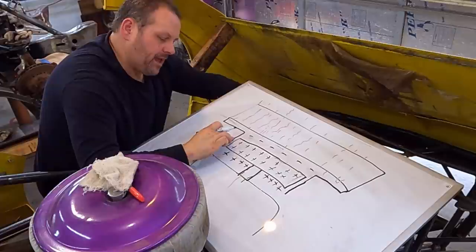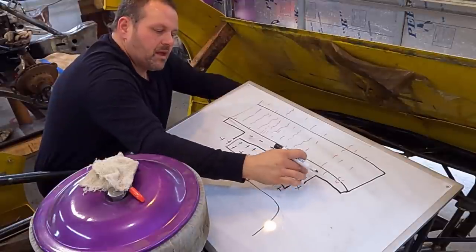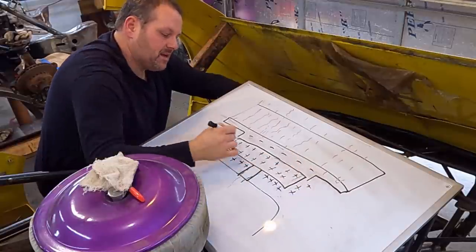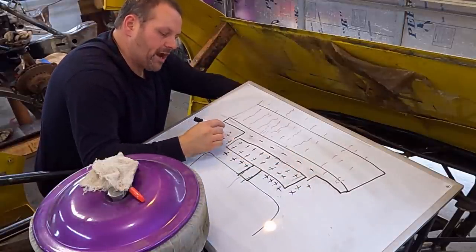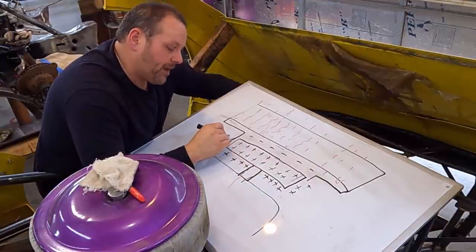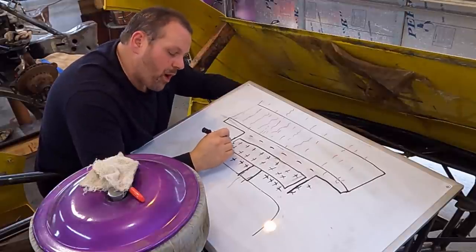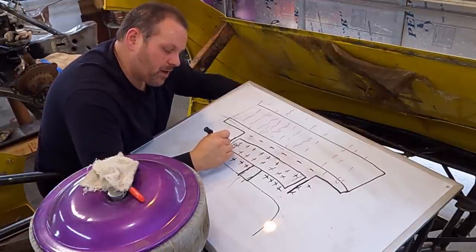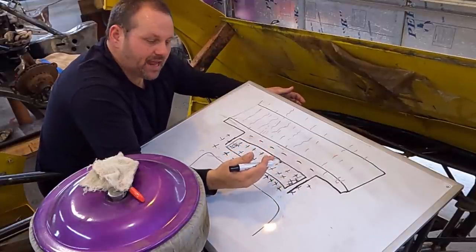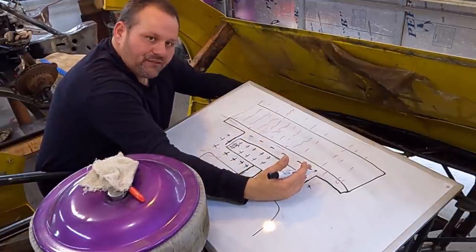And for that reason alone, plus a couple more we're going to cover, if I open that up, as long as my fan shroud extends past that leading edge, I'm giving this high pressure zone a larger area to evacuate from. So I'm letting that air off. And there's a couple more things going on. In reality, when you're deep like this, the pressure zone or the wave is even higher out on the edges of this fan. So the highest pressure, the most resistance to the air movement, whether it's being gathered up and squeezed, is right out against the fan shroud.